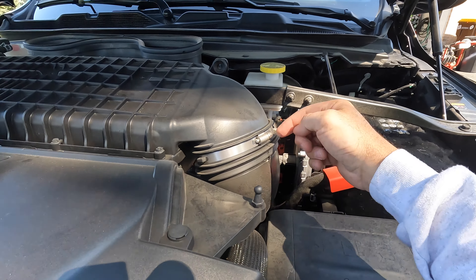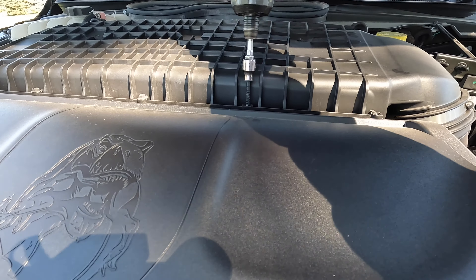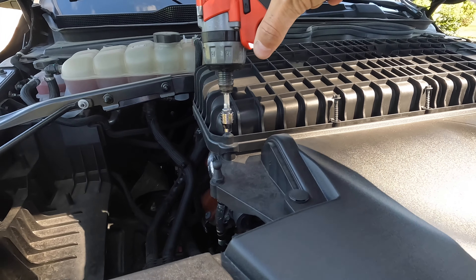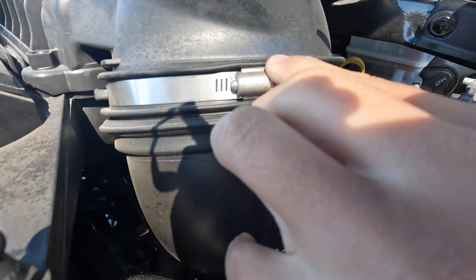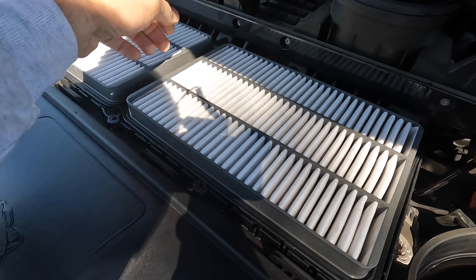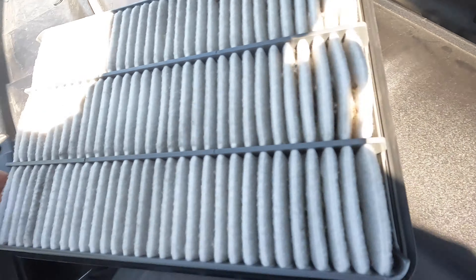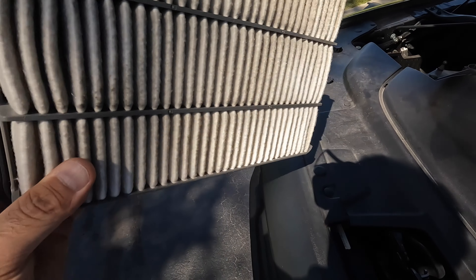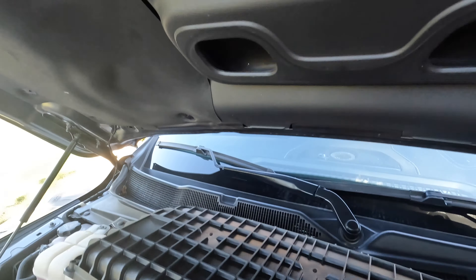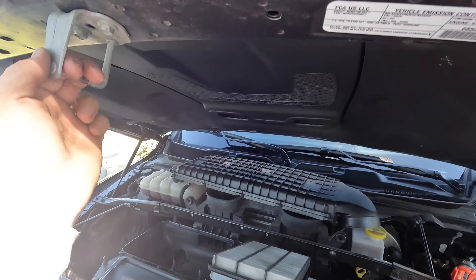We're going to take these two screws out — eight millimeter — all the way around the entire air box. Charlie's going to loosen the hose clamps here on the intake hoses. They don't need to come all the way off, just loosen them up real good. Get all your screws out and you're just going to lift that up. And here are the filters. There's some bees and some nasty stuff in here. The truck's got 18,000 miles on it and I've spent a lot of time at this boat launch — it's pretty dusty. The truck does have an active intake, so everything that comes into that hood comes down into these filters. That's actually a real working intake up on that hood.